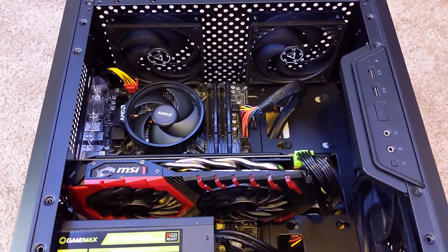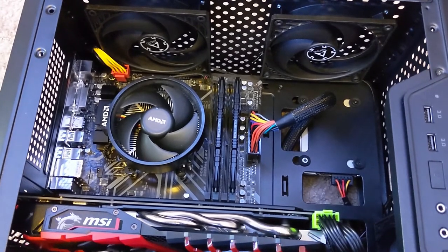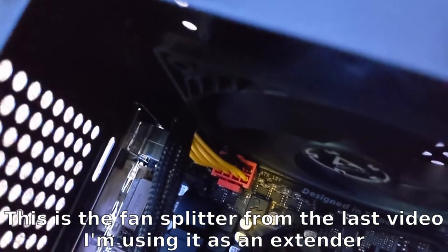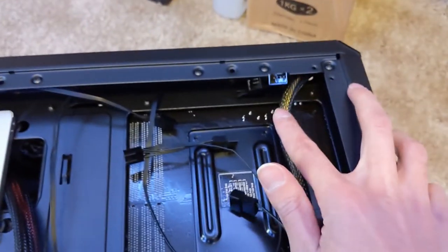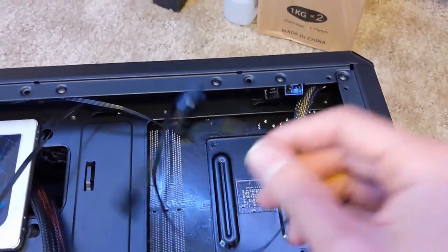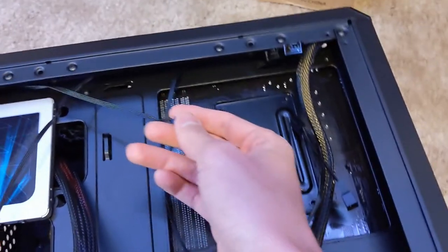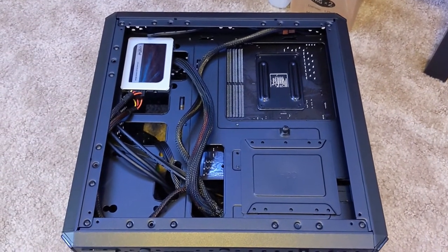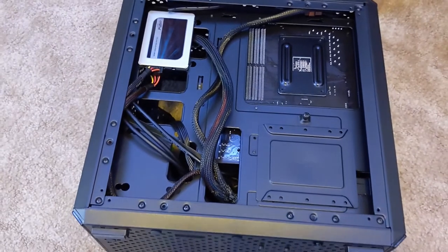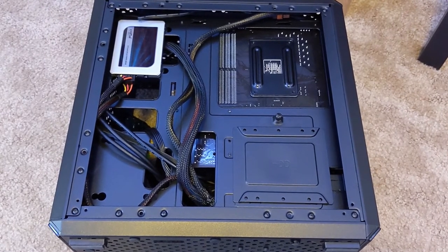And now I got my graphics card back into place. The last thing I've got to do is connect all of my fans to the motherboard and clean up all the messy cables in the back of the case. Now I have it plugged in and it is leading out towards the back through that small hole. At the back here are my three fan cables — one, two, three — and those are my splitter headers. So I'm going to plug one of my 120s into one of the headers, the other 120 into the other header of the splitter, and then the 140 is going to plug into the extender of one of the 120s. Now after plugging all of those in, I have them all tucked nice and tidy into this little lip out of sight and out of mind. Honestly, I don't think this needs to be cleaned up any more than it already looks — since there's so much cable management space back here, the panel is going to close just fine.